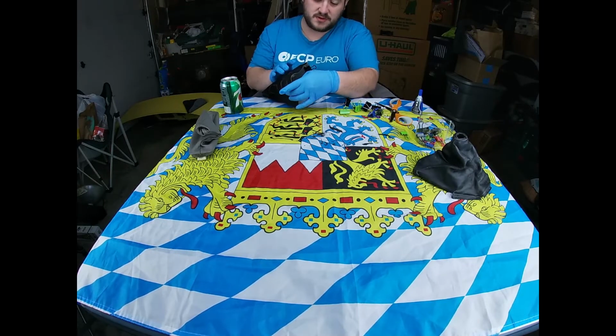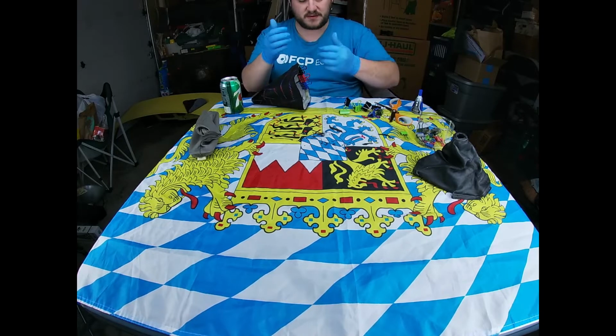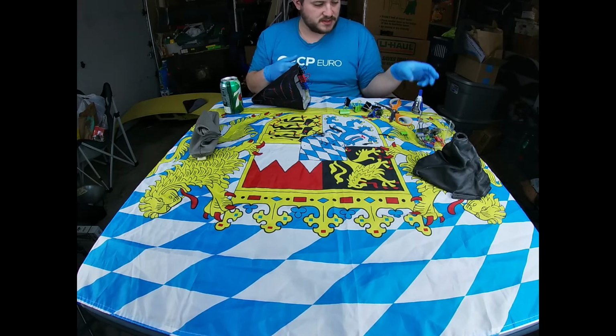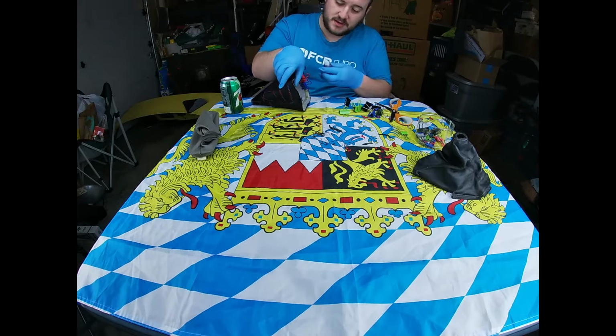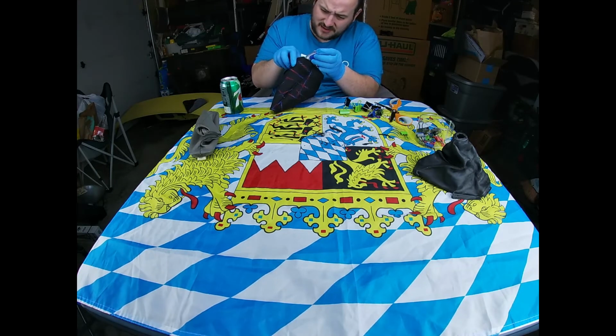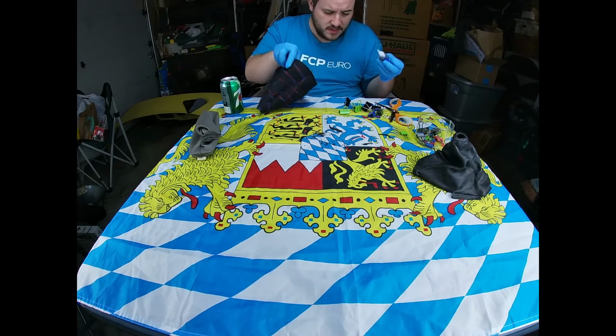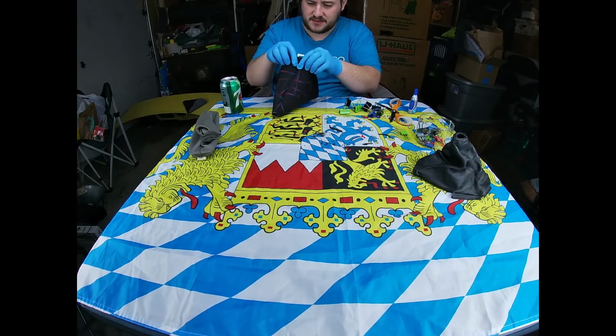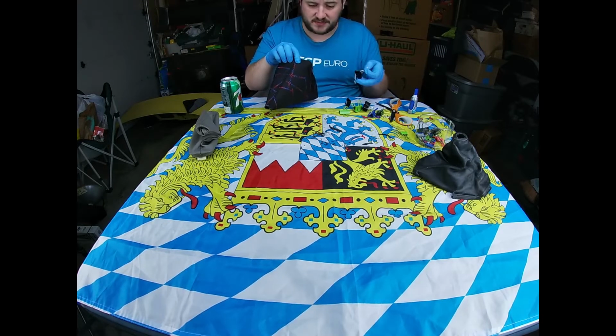And we're going to glue the bottom portion, the part of the frame that faces towards the driver, or the back of the car. So same thing, we're going to take our glue here again, and on the outside of the frame, you're just going to look up underneath here, lift the fabric, and put a thin little line of super glue. And again, leaving the corners unglued, because we'll get to those in a second. Okay, and again, just give it a nice little tug to re-snug up the fabric.